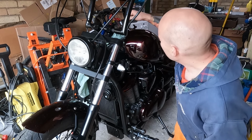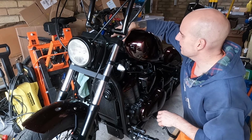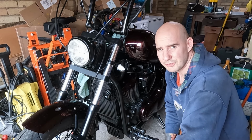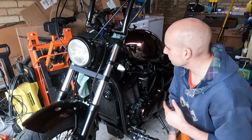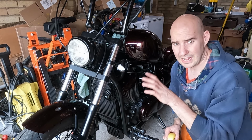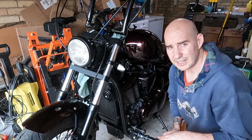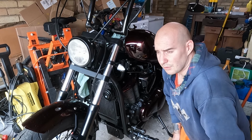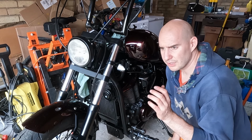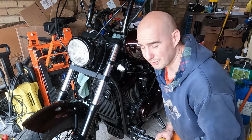You have to move the tank back. All I recommend is you take the controls off the top or the speedo and everything and the cover, disconnect everything and just move it back so you can get on there. Now you can use a funnel and move it back a bit further. Oh, sorry, less further than I have. I just prefer this because you've got to get that cap on quick once you run it up. You've got to run it with the cap off to get the air out, shake it about a bit prior to try and get as much air out of the system, then run it once it starts bubbling or the fluid starts coming out, put the cap on, get it warm, turn it off, leave it for a while, and then do the same thing again by just topping it up, because it should hopefully have it all out by then.